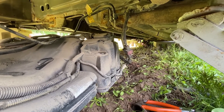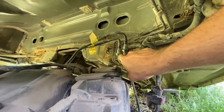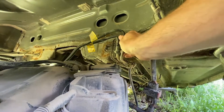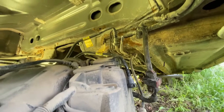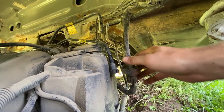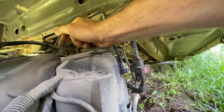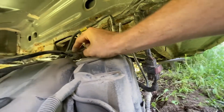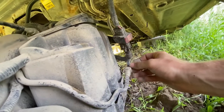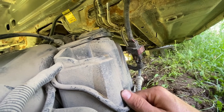We got our tank down. We're over on the passenger side. Right up here are your fuel lines — there's a little clip here. You pull those out and then wiggle and pull these off. You'll also need to pull out this red clip so you can unattach this connector. There's another fitting of the same type, and one more after that. So you've got four total of these kind of clips to undo, and then you should be able to pull your gas tank out.